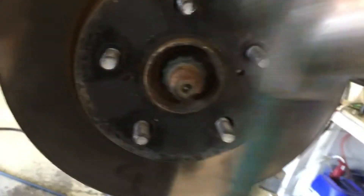We'll just get rid of this and chuck it on the bench. Next, what we're going to do is hit the rotor on the face of it, right on the edge of that center drum, and we're going to have to turn it to different parts and do the same thing. Make sure you don't hit the wheel studs. If your aim with a hammer isn't good, thread the nuts back onto the wheel studs so you don't damage those threads.